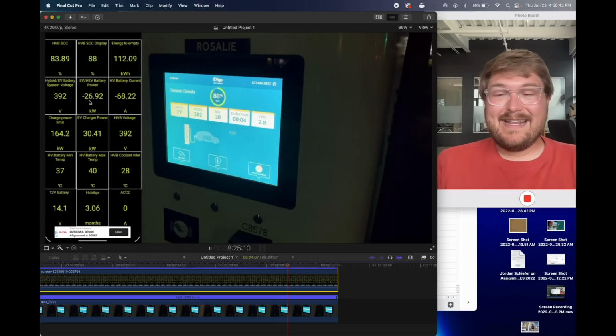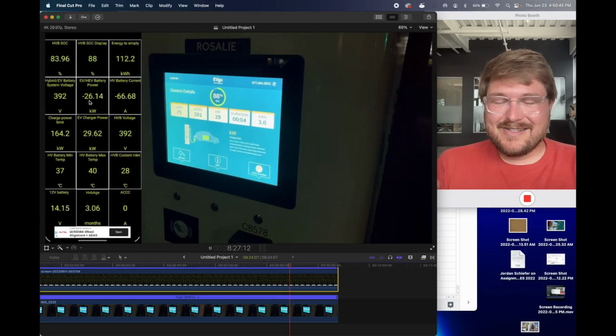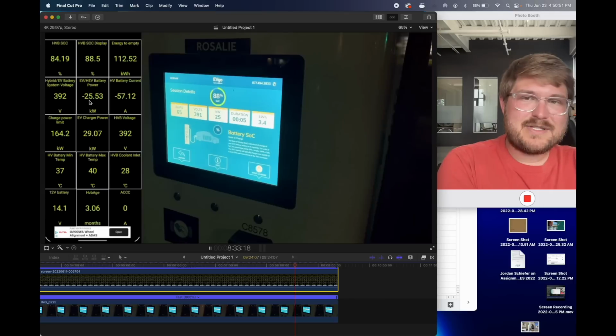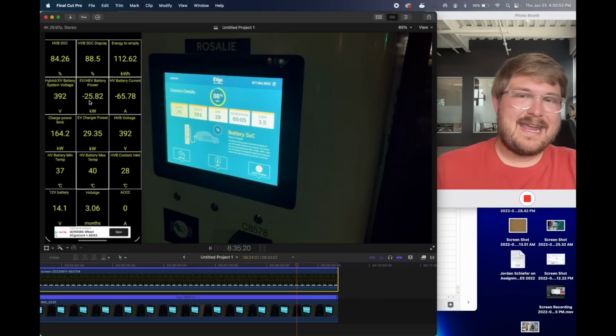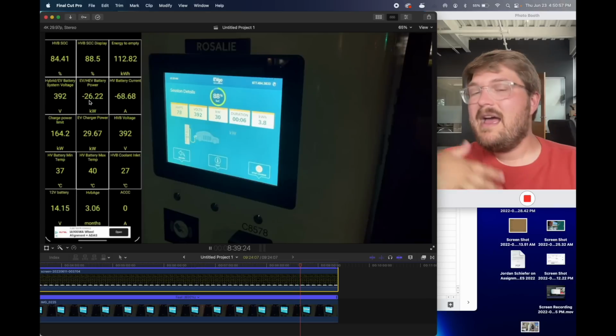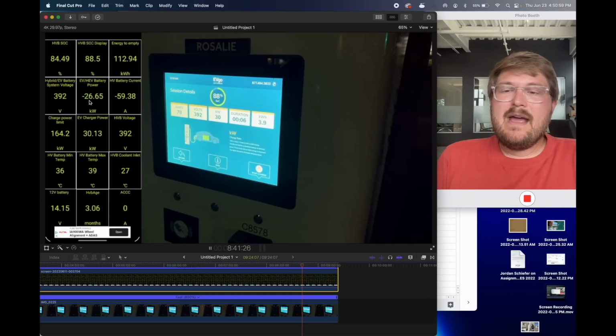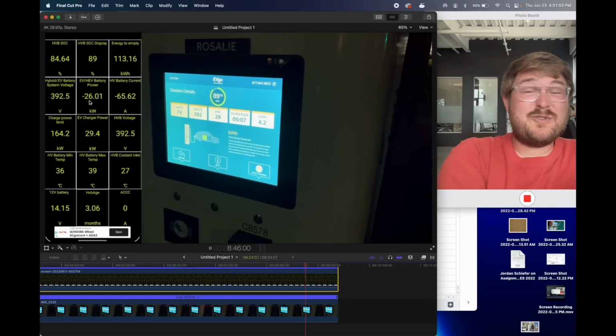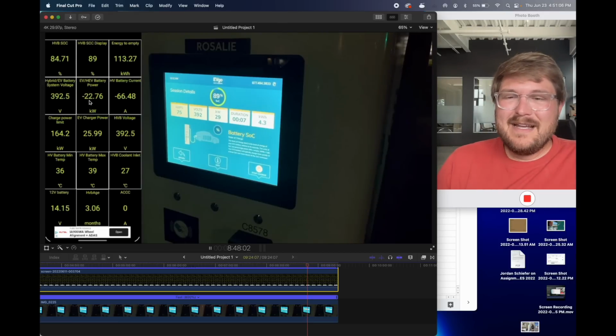Even more infuriating than this whole set one-time charge limit is it's actually no faster to DC fast charge this truck from 90 to 100% than it would be to plug it into an 80 amp level 2 charging station, which is the maximum J1772 and the F-150 can handle. At 90%, it basically sits at 20 kilowatts and then walks its way down to 1 kilowatt all the way up top. And I actually have that all live streamed on Out of Spec Motoring.